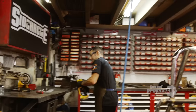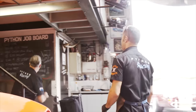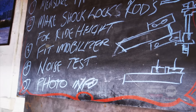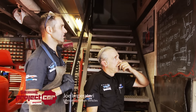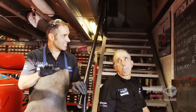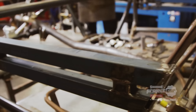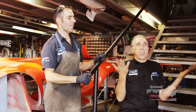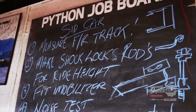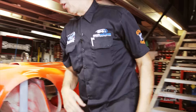Tom walks Joe through the intrusion bar drawings. Tom wants to go up to 10mm, but Joe is concerned: "If we go to 10mm, don't you think that's just going to be too heavy on the doors? I'm worried about rego and the engineer's report. Can we try 8mm? I don't want a heavy door sagging over time." Tom counters: "10mm is going to add safety against side impact intrusion, so you might as well go to 10mm — I'd rather go heavy than light, that way we're covered." Telpho jokes he'll stop interrupting but still needs to keep them in the loop.